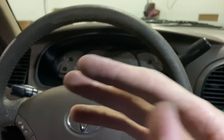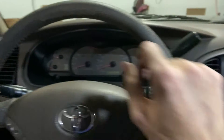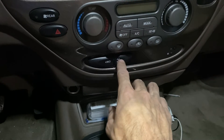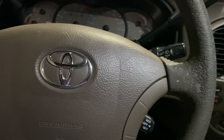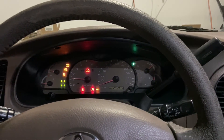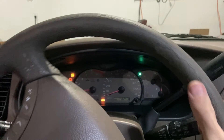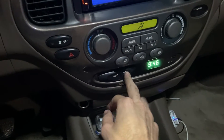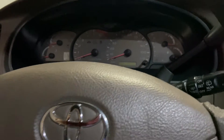We're going to start it and let it run for four seconds. Then we're going to turn the wheel at least five degrees in either direction and then bring it back to center. And then down here on the dash, either your track button or your center diff button if you've got four wheel drive — press that three times within three seconds and we should hear a buzzer sound. That indicates that zero point calibration was reset back to zero. So wheel is centered, start it up — go five degrees, back to middle — and then key off and jumper out.